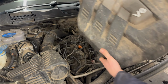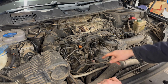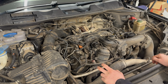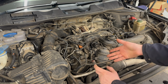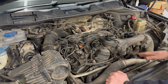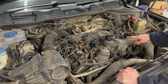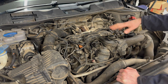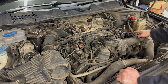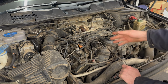Basically, the issue I'm having is the injectors are in the head, so the seats are within the rocker cover, and if they leak, they pressurise the crankcase or the rocker, and this causes diesel fumes or diesel vapours to be present in the crankcase. If you open the oil filler, you'll see the fumes come out. Also, because of the pressurising, it can cause oil to leak where it otherwise wouldn't.